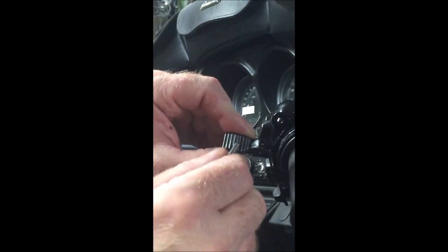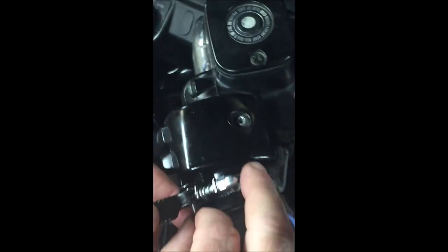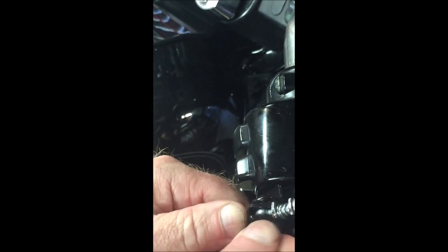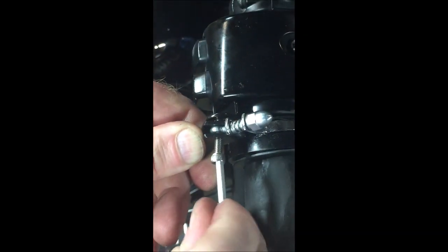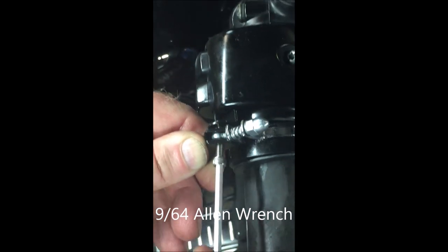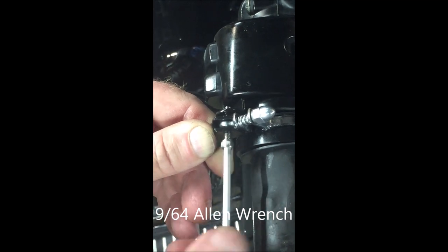Notice this side of the set lever — that's what it's called. You're going to take it and put it up here by this eye bolt, and slide the bolt through just a little bit to make sure it pokes through on the other side. Then line it up to the bracket you installed earlier. You'll have to twist it a little bit to get it started in the hole, then tighten the allen bolt until it just starts to poke through the bracket.